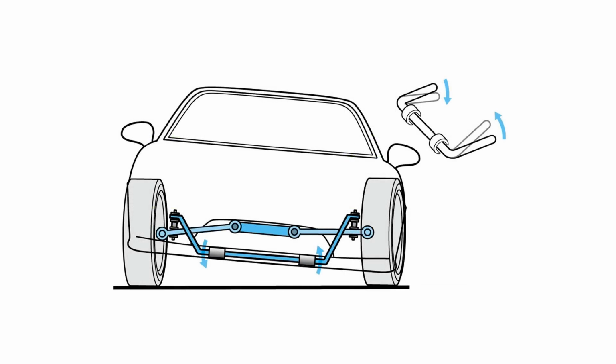These do exactly what their name says. They prevent the front or rear of the car body from rolling. They also adjust the amount of load distributed to each end of the car, so the roll bars will be one of the biggest knobs that you can turn for quick handling changes.